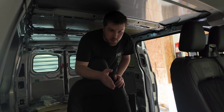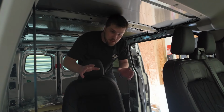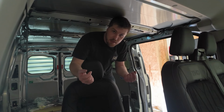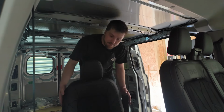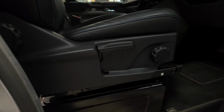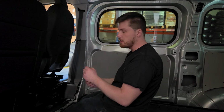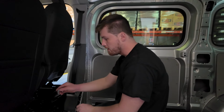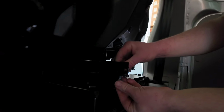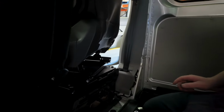So I've realigned the swivel adapter straight just while I put the seat on, just to make it easy to locate it. And then once the seat is just resting on, I will spin it at 45 degrees again to gain access to the fixings to do up the seat to the adapter. So with the seat now sat on top of the seat adapter, it's time to put the bolts in. So we want to put bolt and washer on the top and then the nut underneath. Okay. And then do that for all 4 and then we'll tighten them up after.